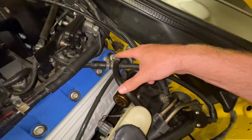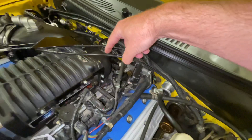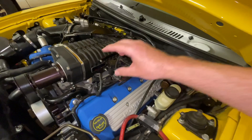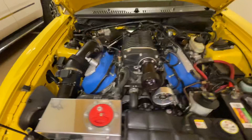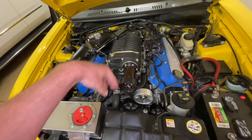The other side of the tee is coming from back here on the cam cover. Sometimes you'll route it so you have a catch can here like I do, but basically from here it goes into this hard line and tees into the back. Both of those — from the lower intake manifold and this one — come from the back of the blower. That's helping with oil, moisture, and pressure inside the cam cover. On this side, the hose goes into the intake — we've added a pre-filter to catch some oil and help keep oil out of the intercooler.